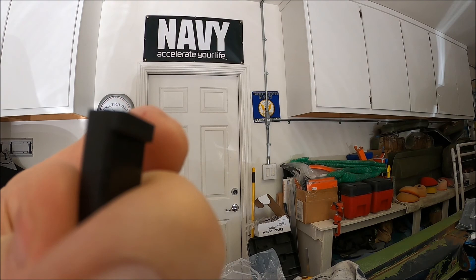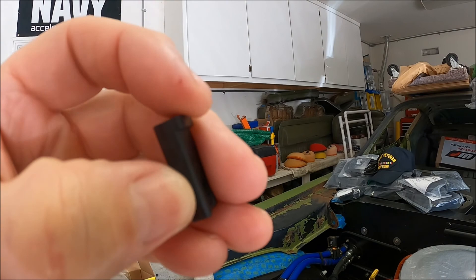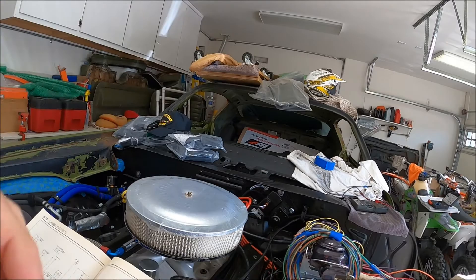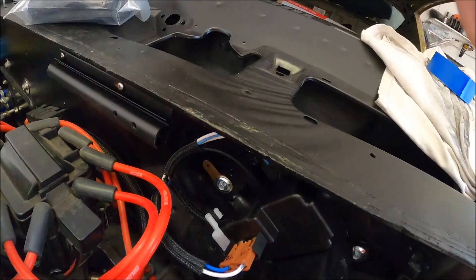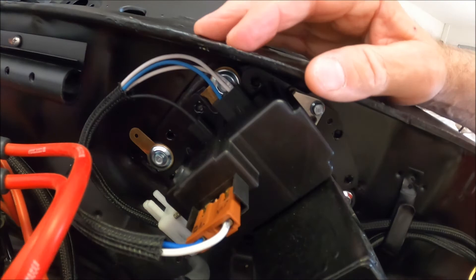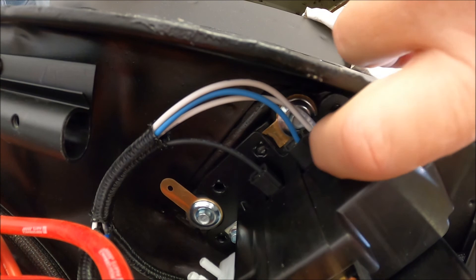The connectors have a step side on this connector here — that's going to face the firewall. So even if you try to plug it in backwards, it's not going to go because of the indexing slot. This is what gets used for the low speed connector. These are the indexing slots showing the orientation on the washer, and the indexing slots back here face the firewall.